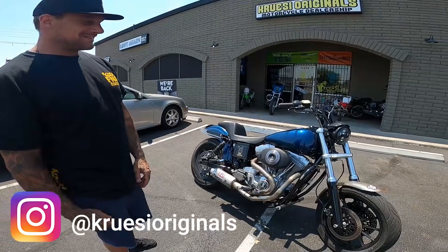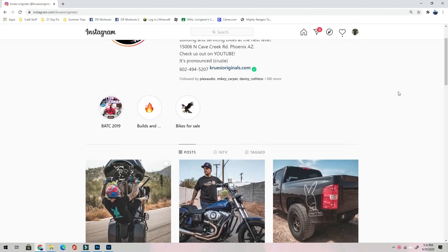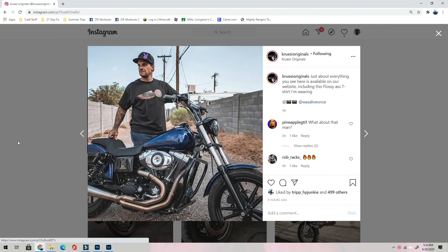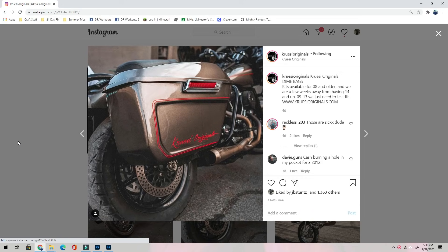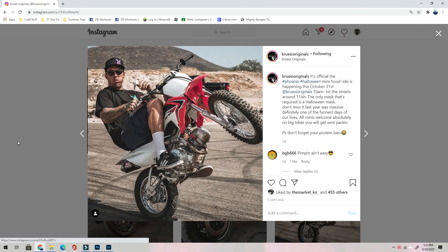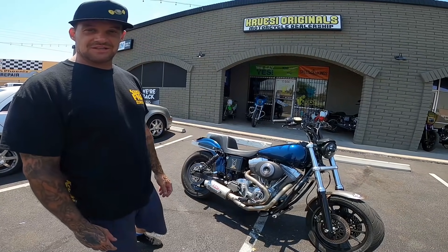This is my personal stunt piece — it's all blue, an '01 FXD Dyna Super Glide. 2000 to 2002 is the best stunt bike you can get Dyna-wise. They've got a Timken bearing bottom end, which is definitely what you want — the crank doesn't walk side to side when you're clutch dumping. They've got a smaller, narrower frame, they're shorter and lighter than the '06-and-up late model six-speeds. The balance point is so forgiving it's almost cheating.